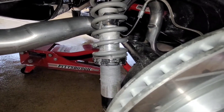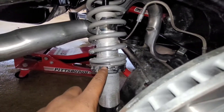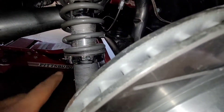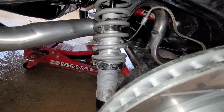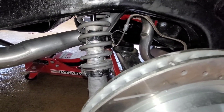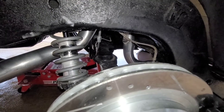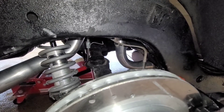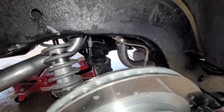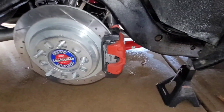What I did on the back but not the front — I have three shims. There's a shim that sits in the middle with rollers on it so when you adjust it, it's easier to do. I didn't put them on the front because I didn't think I'd be adjusting them as much, but I've adjusted the front more than the back. Let me tell you, if you don't have those on there it's hell. I won't pull them all the way off at this point, but if I ever do another car with coilovers, they're definitely going on all the way around.